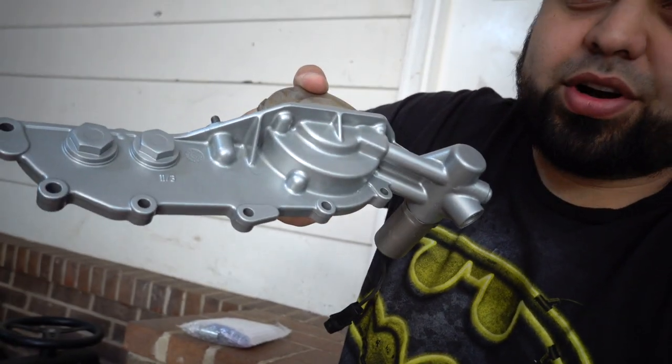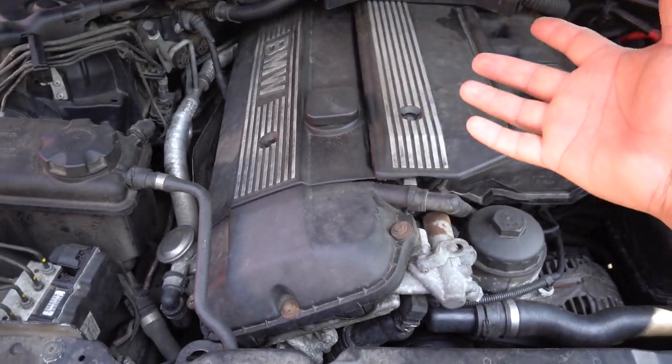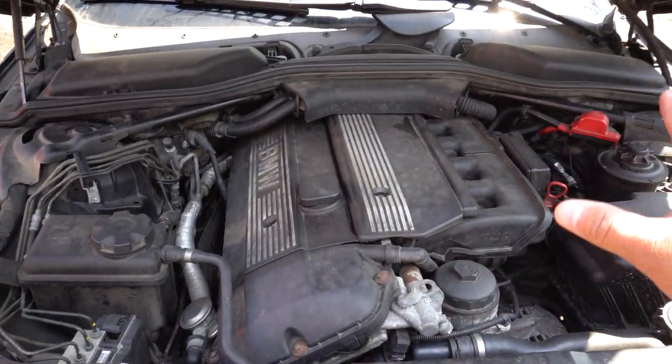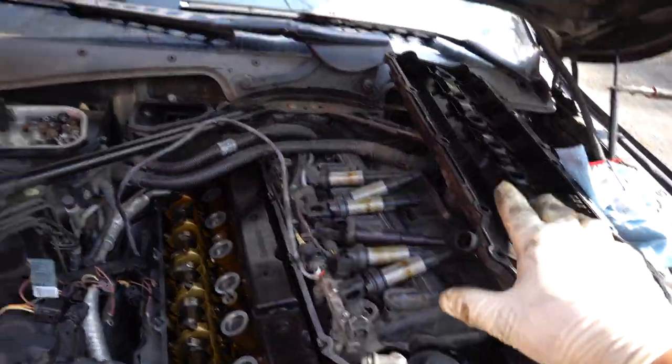Since I'm doing that, I thought I would make this video even sweeter. My E60 has a dual vanos system, and we're swapping a motor in the E30 — that swap has a single vanos system and I just got done powder coating it. I'm going to knock out this seal and anti-rattle kit, and since this video is only about the vanos system, we're not going to cover the disassembly in detail — we're just going to go ahead and get to it. We got the valve cover off and the whole cowl assembly off, so now we have the vanos system exposed.